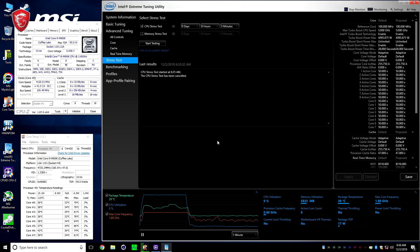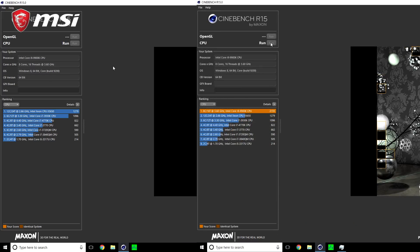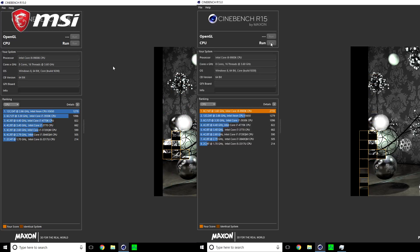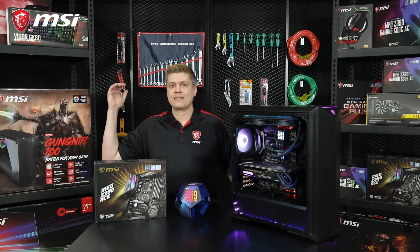For a live graph readout of your Intel CPU, Intel has their own excellent Extreme Tuning Utility, which has a stress test as well as indicators for thermal and voltage throttling. Our first test will be running Cinebench R15 for a primary stability test. In our testing, the 9900K went from 2,009 points at stock to 2,167 points at 5 GHz — that's an increase of over 158 points, or an 8% gain, and that's pretty impressive. For a torture stability test, Prime95 version 27.9 or higher will test AVX instructions; half an hour is a good quick test, whereas if it can survive 2 hours, your system is completely stable. If you don't want to push it to the max, a test with version 26.6, non-AVX, will be fine too.